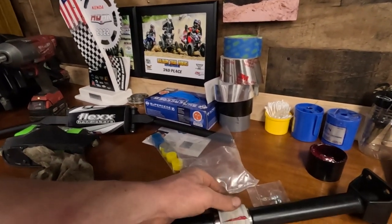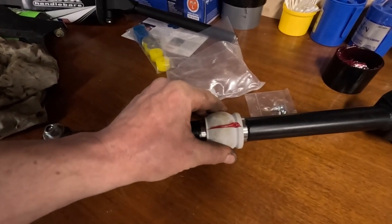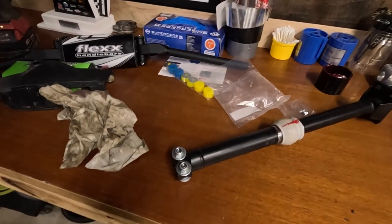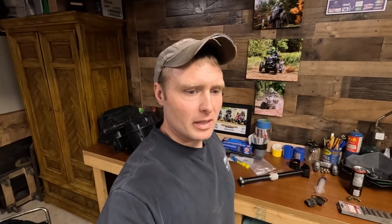I'm going to go ahead and put this J-Parts steering stem in. What I did was I put grease in the steering stem bushing since there's no grease fitting on it. One thing I wanted to note: when putting the pitman arm in, don't use an impact gun because I stripped the nut out. Luckily I had another nylon lock nut. I cleaned the threads out a little bit and put that other nut on. So we're going to put this J-Parts steering stem in and that will wrap up today's video.